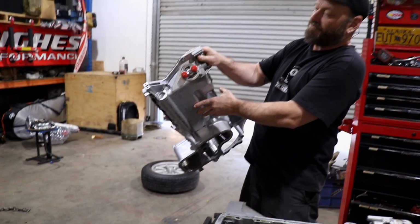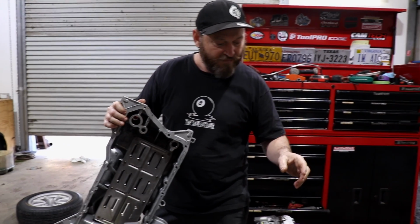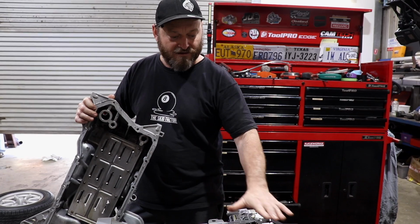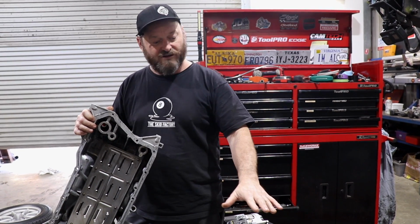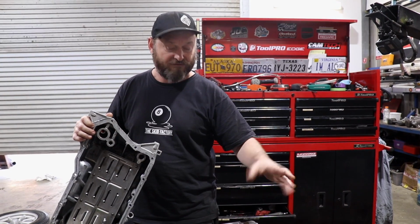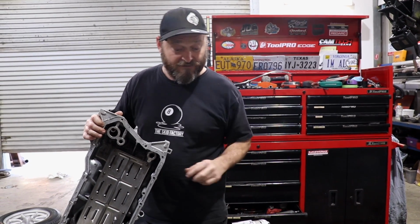So the oil filter's on the front here. It's been modified by Nelson to take AN lines to go through an oil cooler. But these two are the same height, but this one's not. So it's not the simplest thing to make a sump replacement for. So yeah, he's designed something in CAD and it's been cut from a billet of aluminium to suit, and then we can just add our front structure on it.